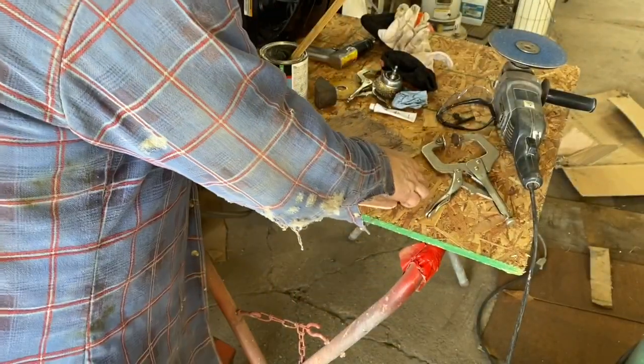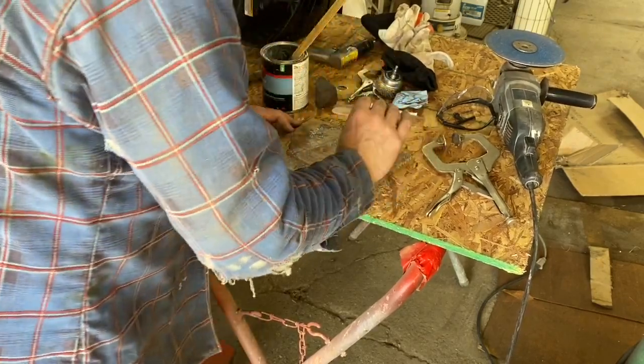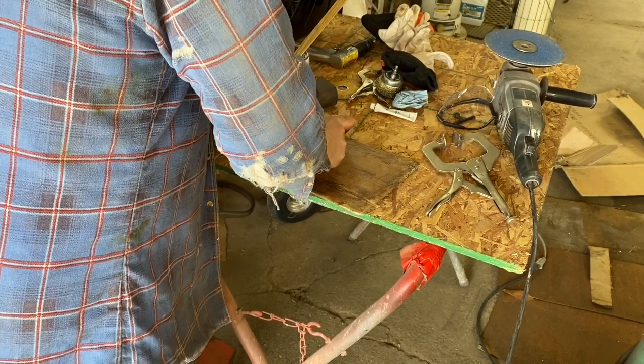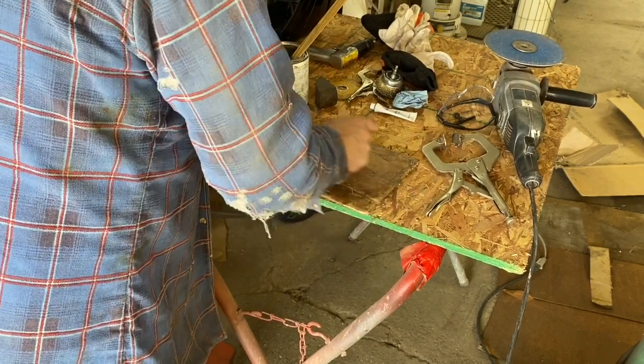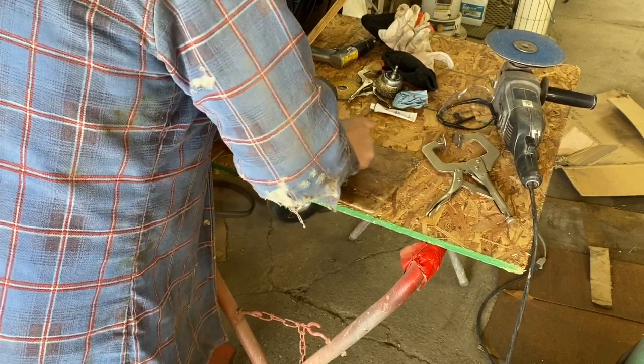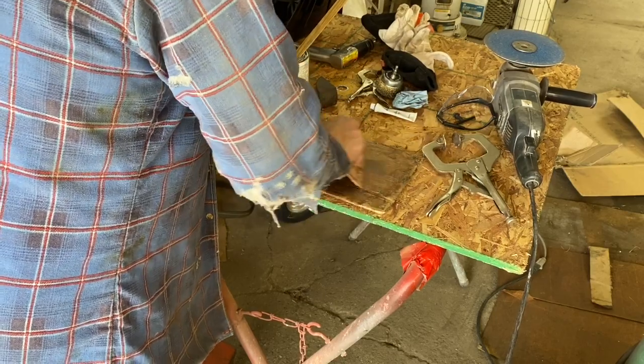Okay, now what I'm going to do is I'm going to come over here and just kind of scrape off both sides of my spreader, just to minimize that. And then I'm going to scrape along this, just like that. And what I'm actually doing is laying out another layer of that fiberglass. Just a teeny hair.